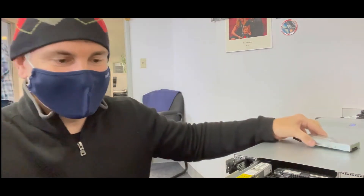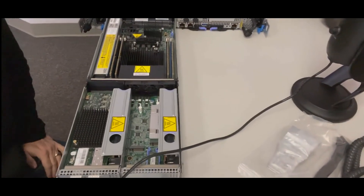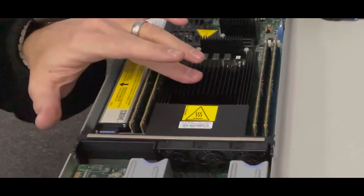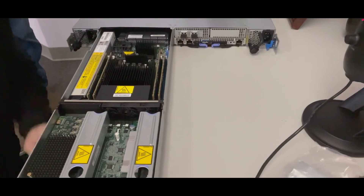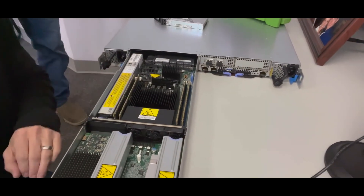We'll see what it can do. Because we'll just show you the controller — you can pop one of these out. There are two active-active controllers. You can put it into an advanced cluster if you so like. Here is your 8-core Intel processor. There are 64-gig DIMMs each, and 256 gigs of cache on just one controller here.